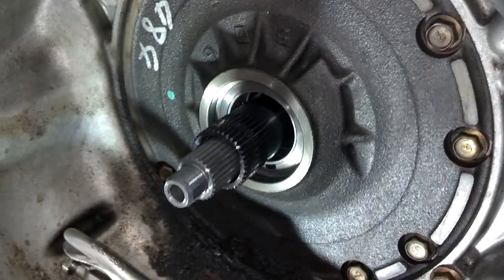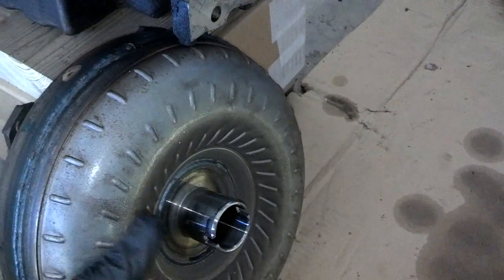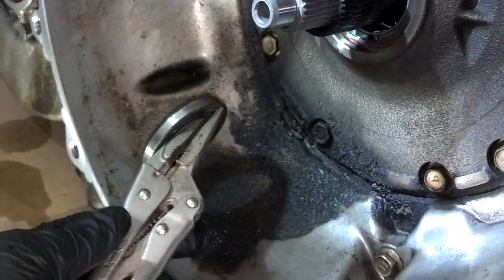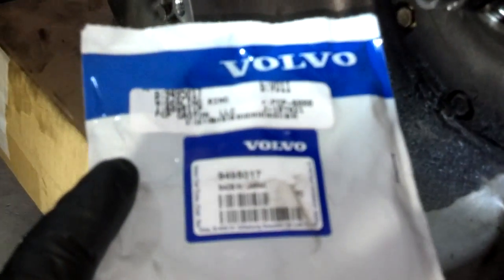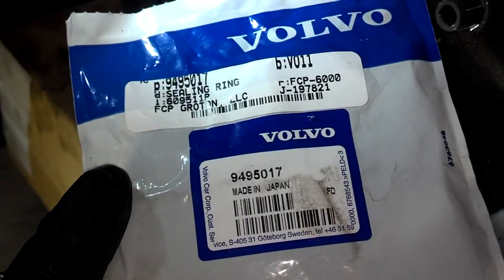To get all this stuff apart it's best to do everything you can, so we lifted the torque converter away from the transmission. We set it on the ground — the torque converter has fluid in there so you don't want to tip it over or the transmission fluid will come out. Then we pulled this seal here using needle nose vise grip pliers. We're going to wipe that off and put a new seal there, put a new seal where the axle goes, and put a new seal on the other side. You definitely want to go back with Volvo seals — please don't try anything else.